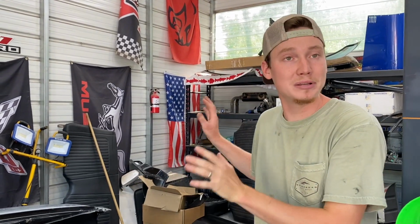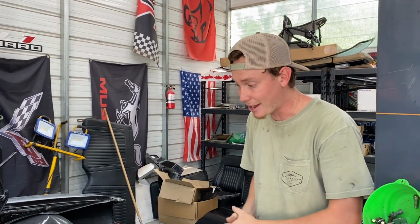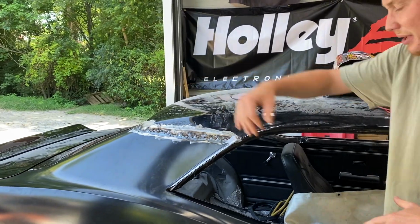I say that's probably the best idea, because body panels, you can always put them on later, and on top of that, if we put them on and align everything, we're going to have to pull everything back off. So I say we just focus on these welds, smooth everything out nicely, probably throw some primer, and then start doing some body filler on the back over here on the quarter panel edges, because that's the most important thing right now, right?